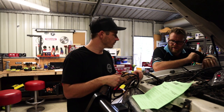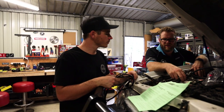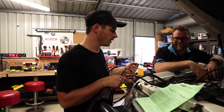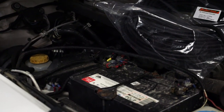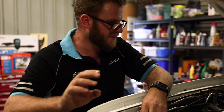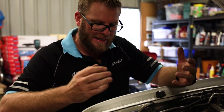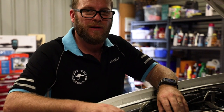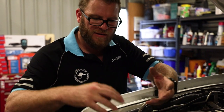It's literally just little things like that which you probably already have kicking around anyway if you do a few little jobs. A little tip: if you are doing wiring, it doesn't hurt to make the wiring just a slight bit longer than it needs to be. If you make it too exact and there's a mistake somewhere — or someone needs to pull it apart afterwards — it's easier to have a bit of wiring to deal with than a wire that's way too tight. You can always tuck it down or tie it up out of the way.